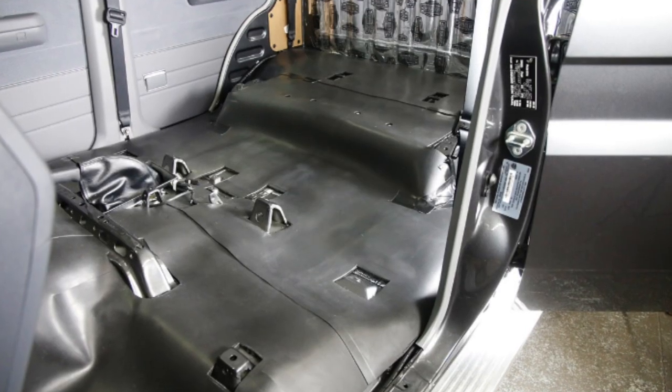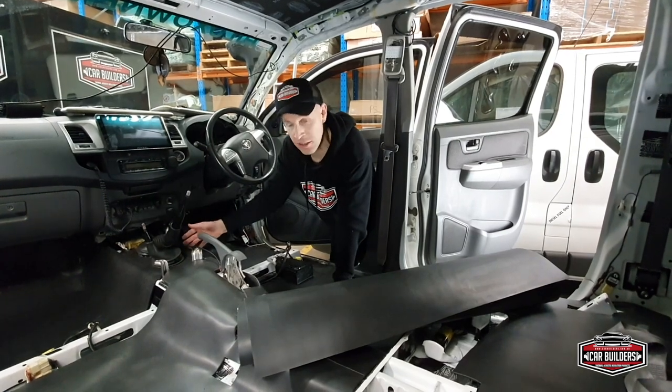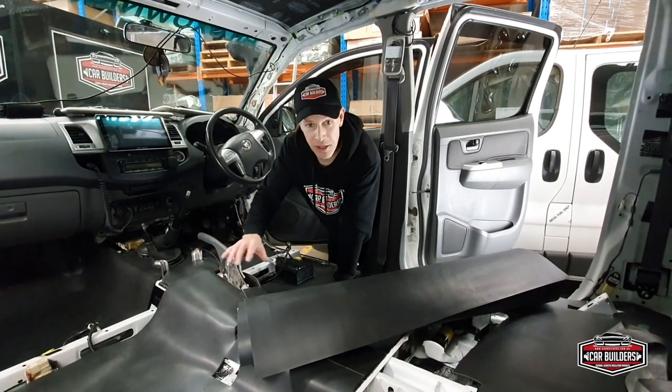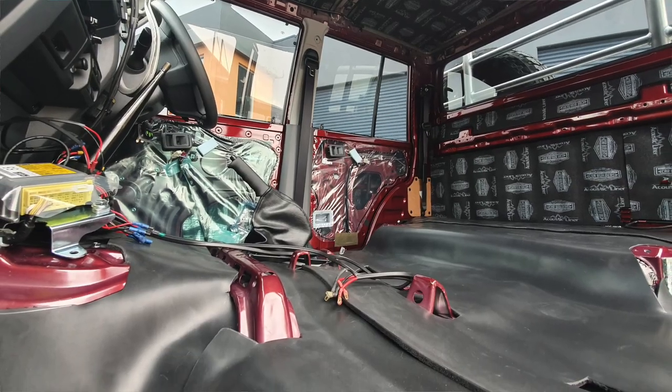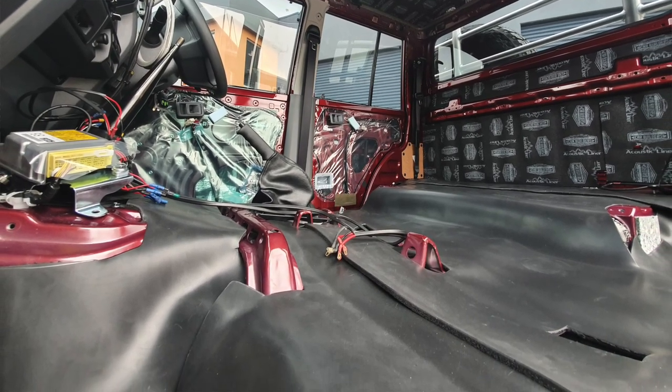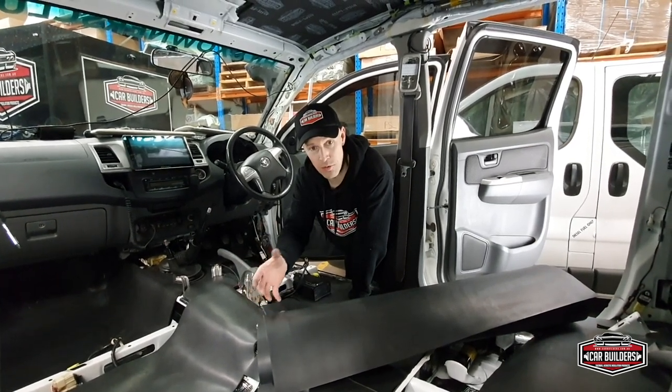Your goal installing this in the vehicle is to cover as much of the floor pan as possible — mechanical areas like the transmission tunnel, firewall, and anywhere where you know there's noise elements underneath. Another advantage with the mass noise liner light is it's a closed cell foam, meaning it's not going to soak up water. It's going to offer you some thermal insulation, and it's also removable.